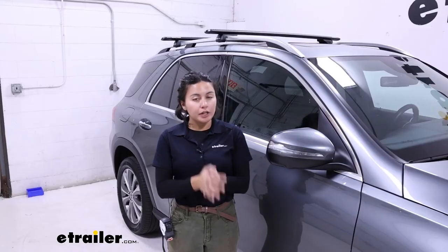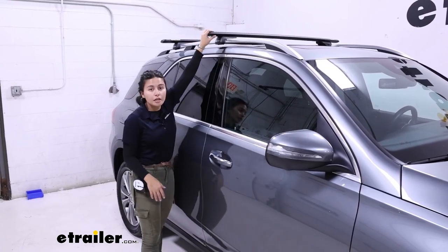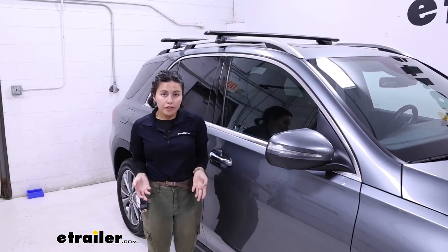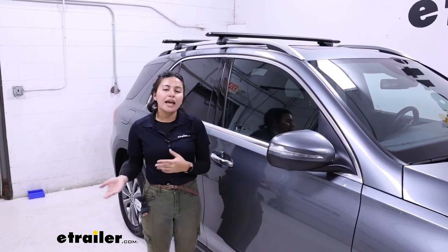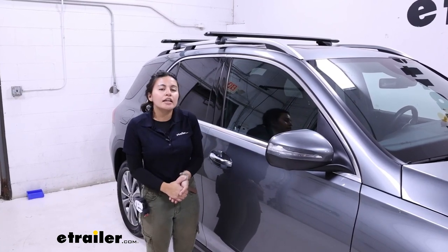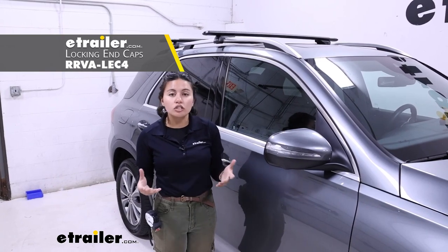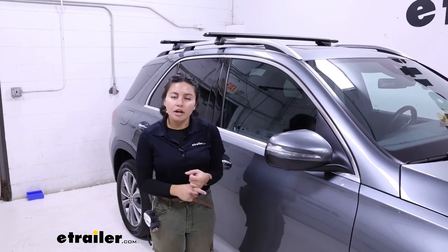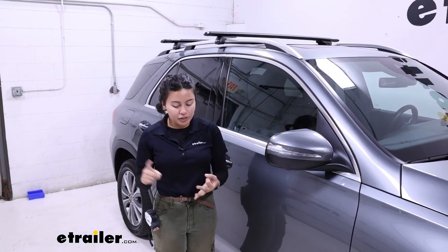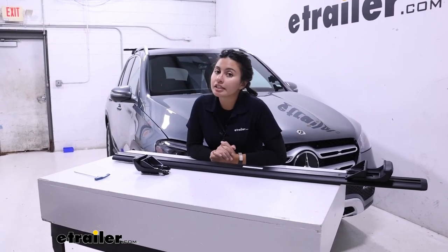My personal thoughts about this roof rack system: if I was to choose, I would pick this from all the other options for the GLE, because I like that extra overhang — it makes it easier to reach up, put things on, and take down your cargo. Another pro is how quick and easy it is to install — it takes about a couple of minutes and is easy to take back off. The downside is it has a plastic end cap lock core, and you'll have to purchase the metal lock cores separately. Also, you'll have to cut the vortex strips if you want to mount T-track accessories. But with a 165-pound weight capacity, how easy it is to use, and the extra overhang, it's a solid choice.